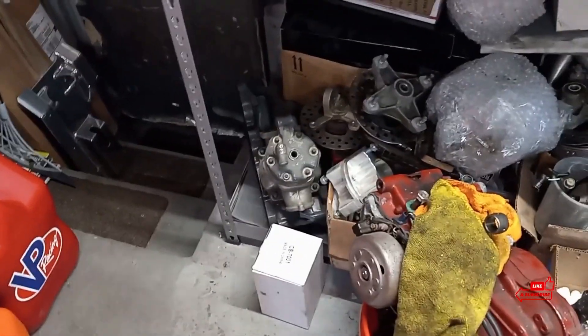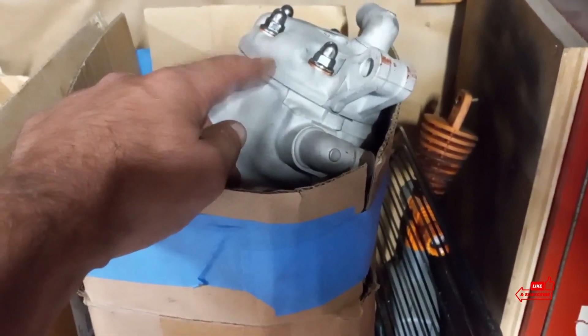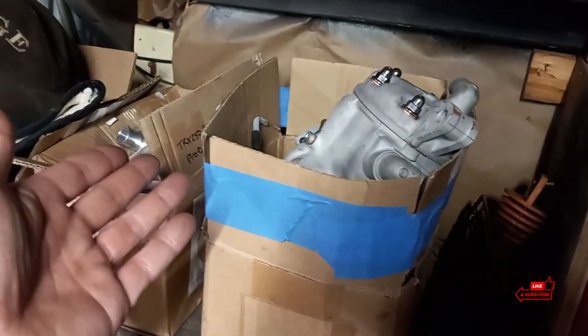Let's breeze through these other parts that I have here. Most of these I already had here because of the other 250R, but like I said, plans have changed with the way we're going to build that one. I have the engine for it right there — there's another 250R engine just chilling there. That's an FSU ported cylinder and I was going to go a certain route. There's the stock cylinder. I have a ProDesign cool head with a dome chilling there — not an O-ringed one, takes a regular gasket. This has a brand new CR250R gasket up by the head — it's a lot thinner than the standard 250R, bumped the compression up a little bit. But I'm not going to be using any of this now.